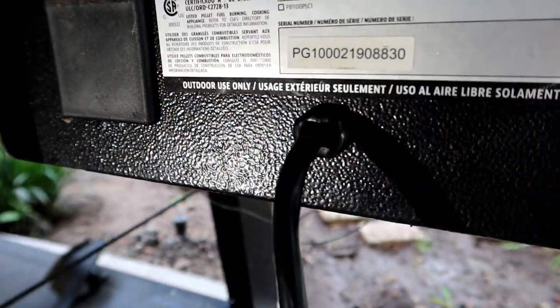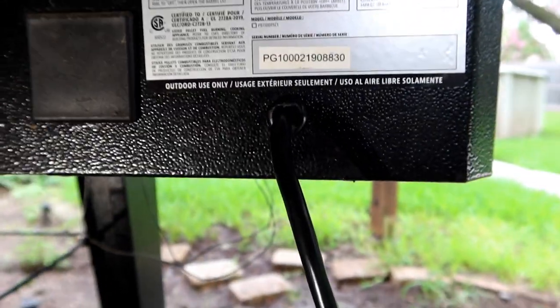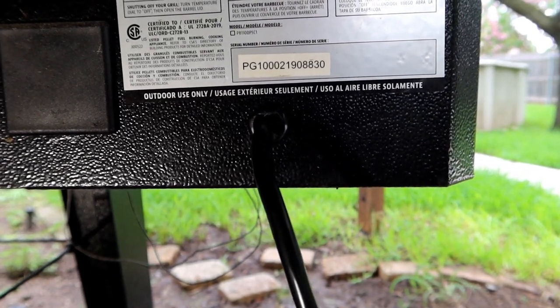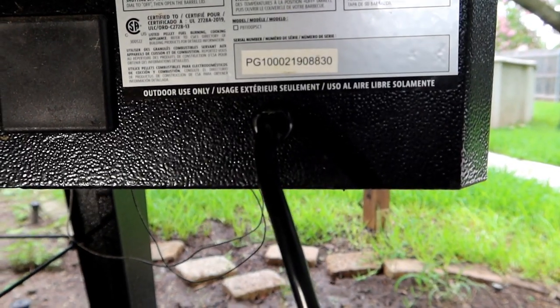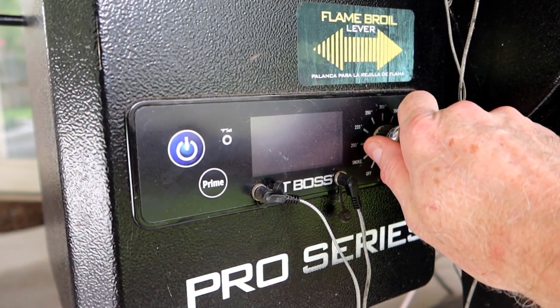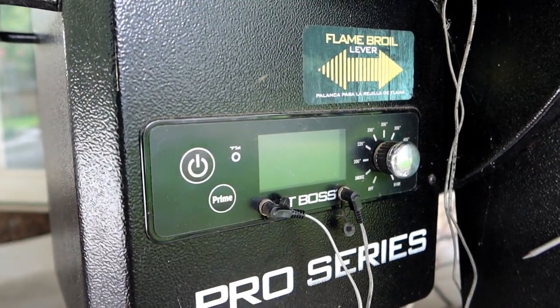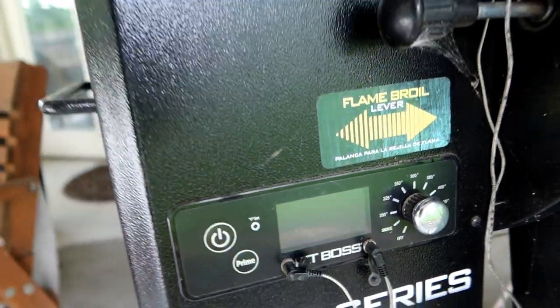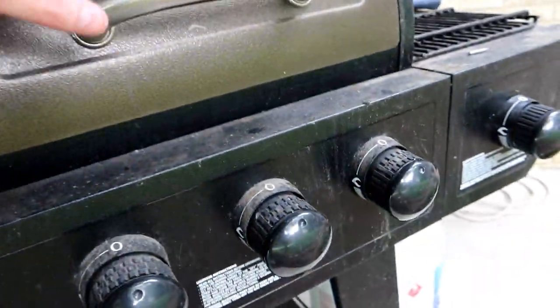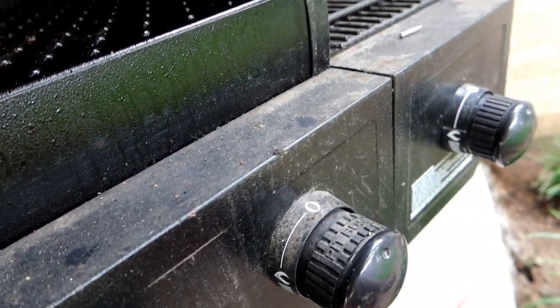Alright, we are back in business. Now before I button everything up on the underside and put the plate back on and close everything back up, I'm actually going to plug it in and make sure everything works. That's always an important thing — you want to find out it doesn't work before you put it all back together, right? So let's turn on the power button. We got lights — that's encouraging. Everything seems to work. I'm not going to go too far because I don't want to heat everything up and start smoking. Let's check the electric ignition. I'll turn on one of the burners and see if it lights up. Yep — electric ignition works. We got fire in there. So we are good to go.